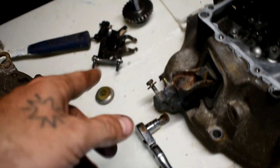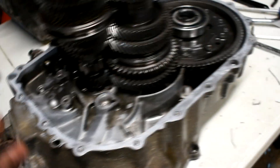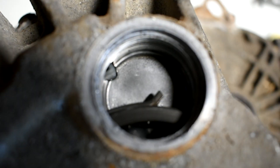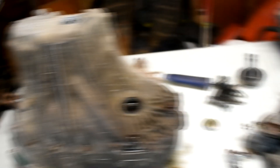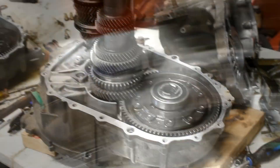So I'm just starting to take apart this other transmission because of all the shrapnel. I haven't pulled the gear set up yet but I've got reverse and all that off, so it's ready to be pulled. I want to get this one out and do a direct swap. This one was definitely not opened before — look how shiny it is in there. Usually that's scratched to death from trying to get the stupid lock off, but there's not a mark in there. So this is probably all factory — that's a good sign, maybe.